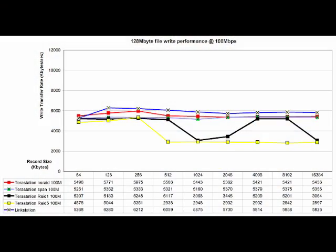One thing I noticed, with further testing still to do, is that the iSCSI performance wasn't great. I'm not quite sure why — I had it on a gigabit network, a known-good network with great response times, but even so, my iSCSI performance was only around the 12 to 15 megabit range. That's a little low for a primary file server. I was running one minor firmware revision behind, though I didn't see anything in the release notes addressing iSCSI performance, so it's something that does need to be looked into.